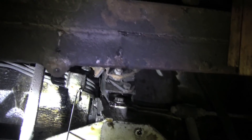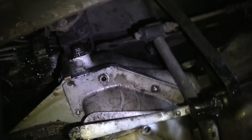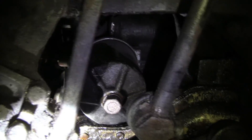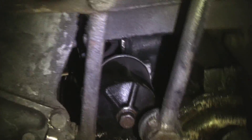This one looks like it probably has a valve cover leak — there's oil coming from way up here. You can see where that drip is, and how this area is all clean, which means it's leaking pretty good — it's washed away all the dirt. The Silver Cloud's front engine has a big aluminum cover with a little rubber strip that goes between the two halves. That is a really common place to leak. On this side the rubber strip is missing — it's a piece of foam rubber stuck between two halves. You should not trim it too close, because when it gets older and drier, it shrinks and will leak.